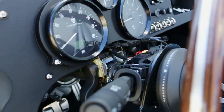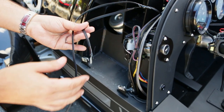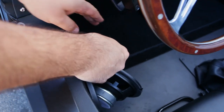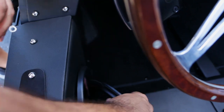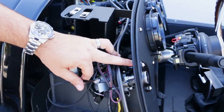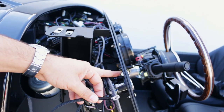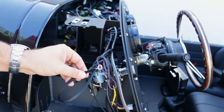We're going to push this back down — the cables are coming through here, underneath this. The next thing we need to do is route these cables. We're going to put this through this hole right here, and you will be able to reach in. This is going to just plug right in — you hear it click — make sure it's nice and locked, and then you can place your speaker back. Next, we're going to take this ground strap and place it to the top bolt of the ignition that holds the ignition on. You can place this ground strap to any good chassis ground. We personally place it here and we've had great success with it. If you don't like that area, just make sure it's a good chassis ground. We're going to go ahead and put this on and come back and reinstall everything.